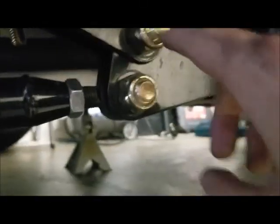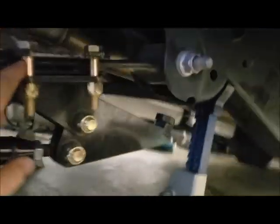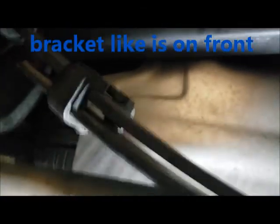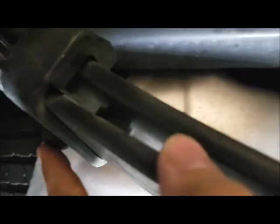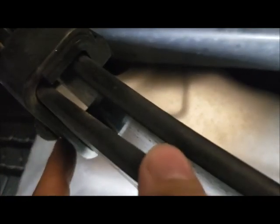Let me go ahead and show you the BAS traction bar and why I chose it. Here's the angle on the traction bar — you've got these two brackets here. Before installing, you have to cut off a bracket that's on there. I'll show you on the rear — that bracket there you actually have to cut. You'll cut about right there, cut this piece off. You'll grind down this rivet and there's actually a spot when you take it off that'll be exposed. You don't want to cut it off smooth — cut it out there. It also comes with instructions.